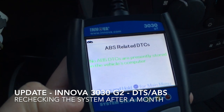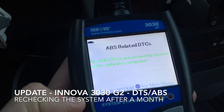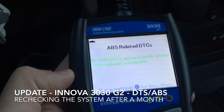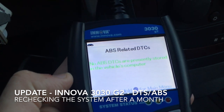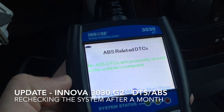As I shared in a previous video, I had two wheel bearings that were out — my front left and my front right — and they showed up here in the ABS DTCs. What's interesting about the Uplander and other Chevy products is that they integrate the speed sensor, which feeds information to your cruise control, from the bearing itself — it's built into the bearing, which means you have to replace the whole bearing.